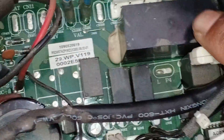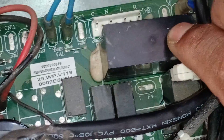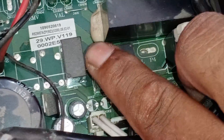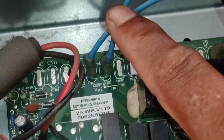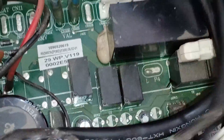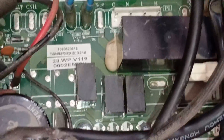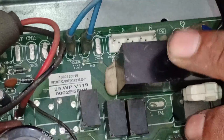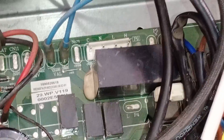The fan will not work fine if any of the two speeds do not work. This is the capacitor installed with the connector — if it's weak, the fan will still not work fine, and this capacitor needs to be replaced on the circuit board. Two relays have been installed after it, and a third relay is also installed for the reverse valve in the unit. These two relays are for the high and low speeds of the fan motor. Either or both relays could be faulty. The fan motor starts, suddenly slows down, and then stops — this means the capacitor could be weak, so I will replace its capacitor and then check the circuit board.